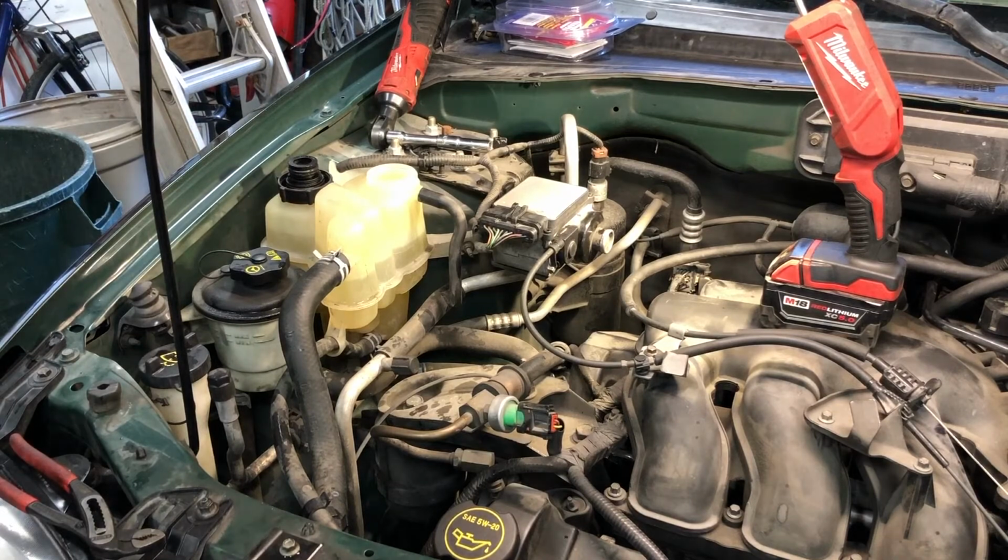And if you want to squeeze that upper radiator hose while you're waiting, that's fine too. The idea here is we just want to get any air that might have burped out with that first go around. Get that air burped out of there and top off the fluid as necessary. So it's looking like it's settled fairly well. We'll proceed with the next step, which is basically to just let it idle until the engine's warmed up.